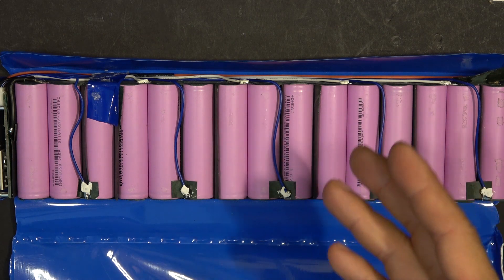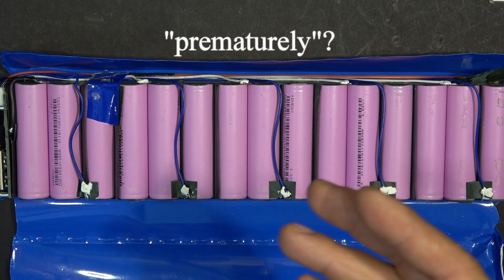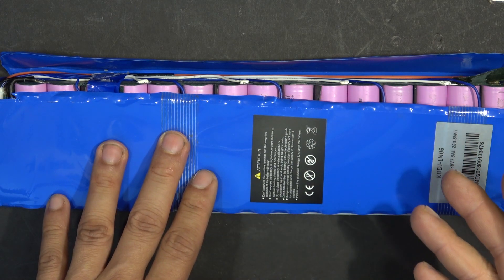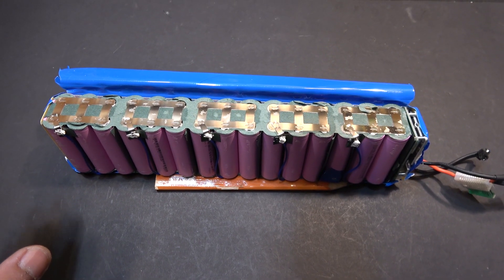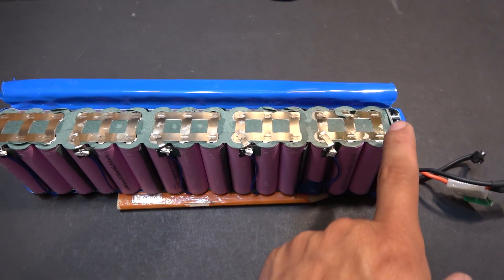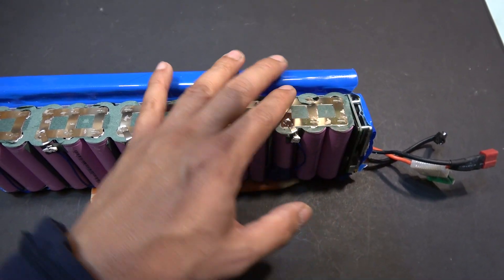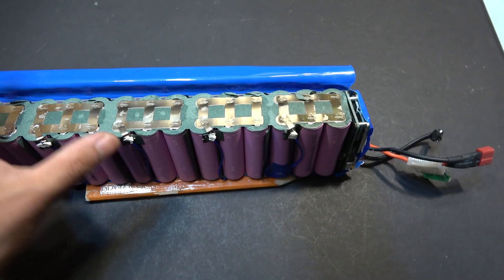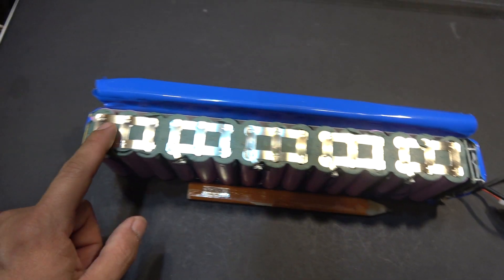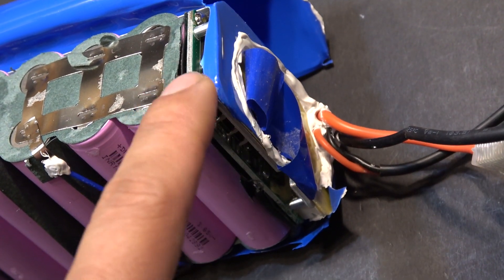This is bad news — maybe that's why my bike dies prematurely when it still shows three bars. This battery pack is not actually 7800 milliamp-hours; it's more like 7500 milliamp-hours. The pack has a total of 30 18650 cells connected in a 10s3p configuration — three cells in parallel, with those groups connected in series all the way down. On the side of the battery pack, we have the BMS, which is very small and takes up just a little bit of space.